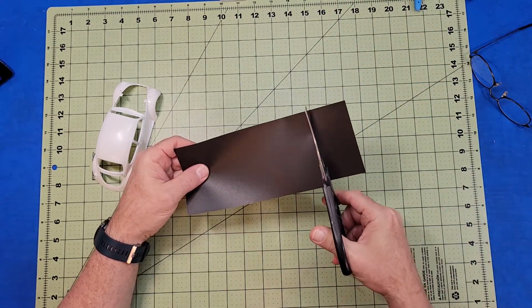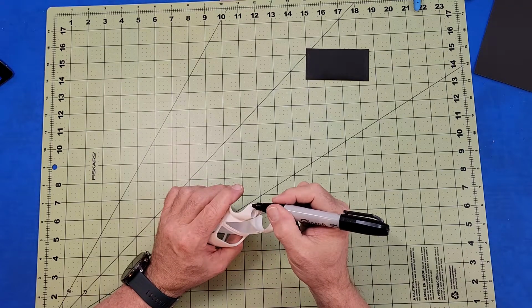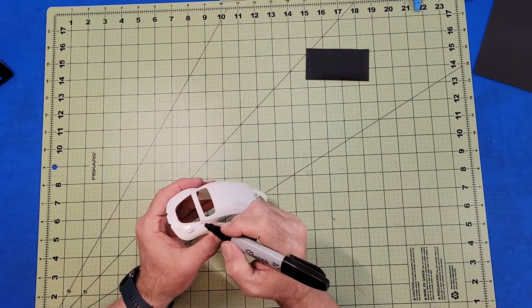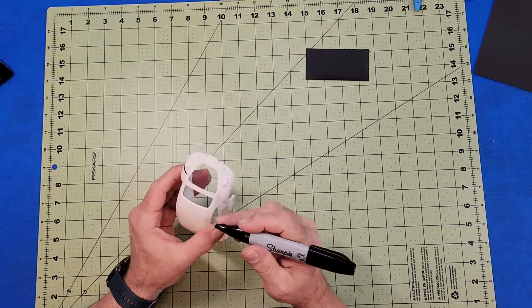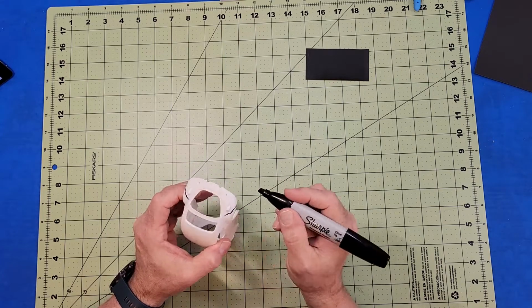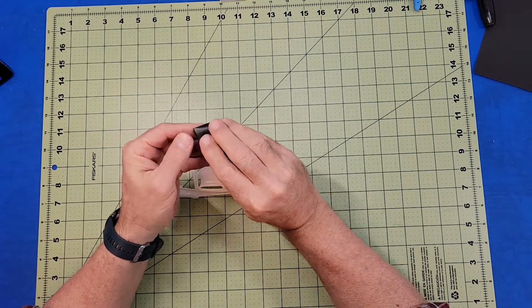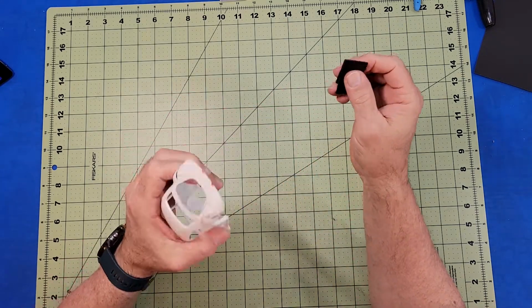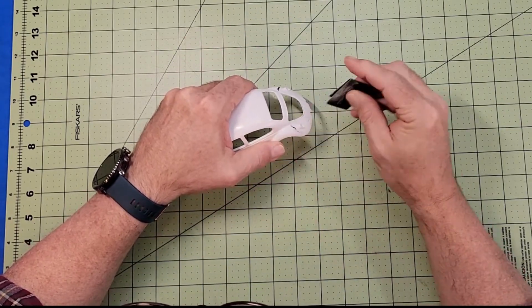I used to help my grandfather restore old cars, so I actually have some experience in sanding and preparing vehicles for paint. And looking at this little guy, I'm gonna need it. I started out looking for any imperfections in the surface and highlighting those with a marker. I then started with 600 grit sandpaper, trying to smooth those areas over.